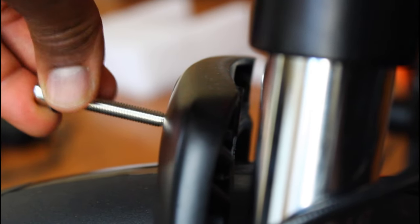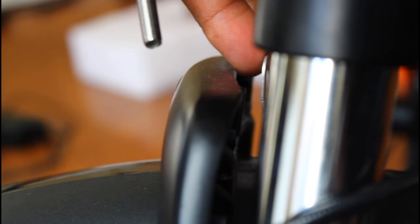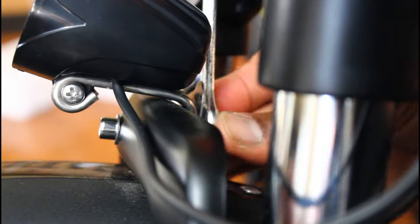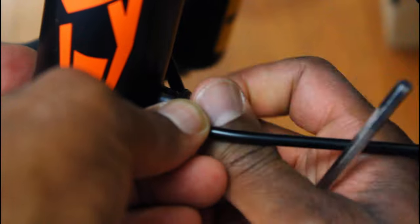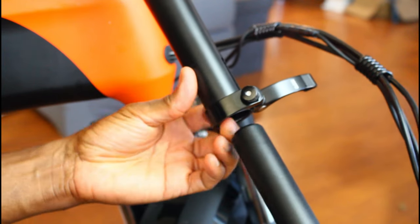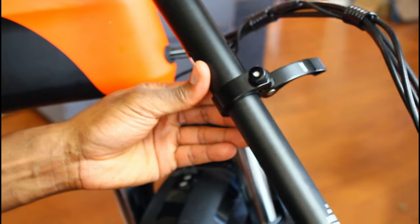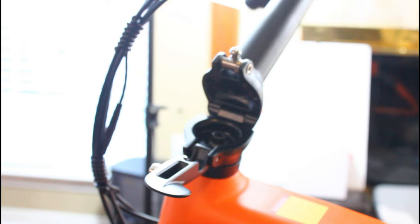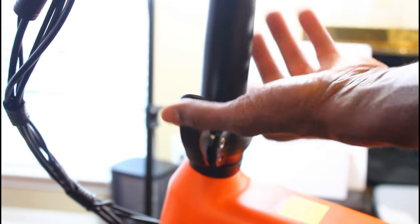To put the headlight and front fender on, I'm going to take the screw with the washer and put it in the front, then put the headlight in between the front fender and the front fork, and put a nut at the end to screw everything in place. For the handlebar, it goes in a specific way — you follow the guider, shove it into the slot, unfold the handlebar, and put the clamp on.